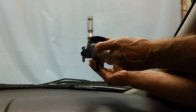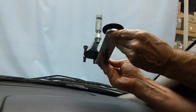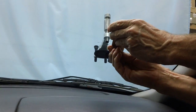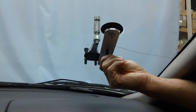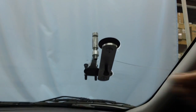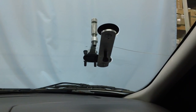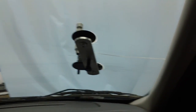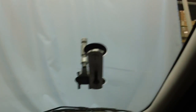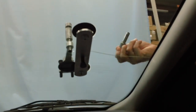When you place a crack opener on, you want to peel the cups back — you don't want to push them on — so that they're relatively flat. I'm just going to flex open the crack so we can get our crack resin in. While we're waiting for the resin to flow down the point, we can inject or slide the edge with our edge crack resin.